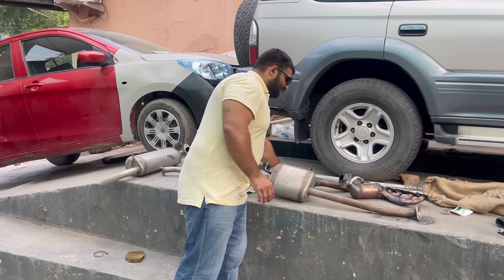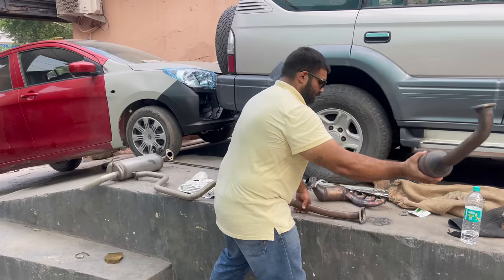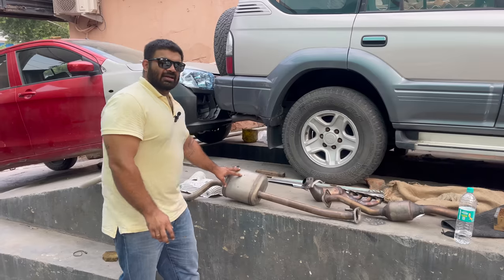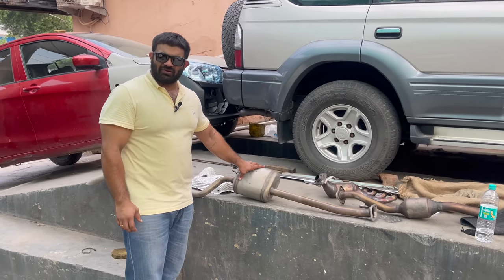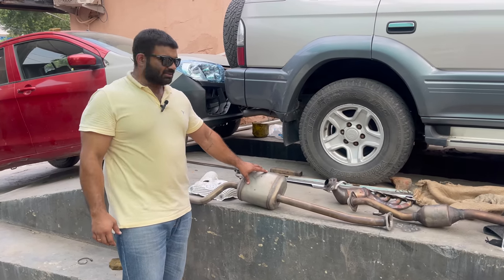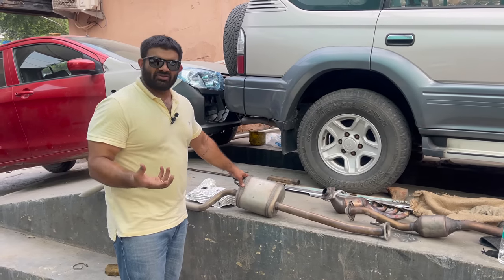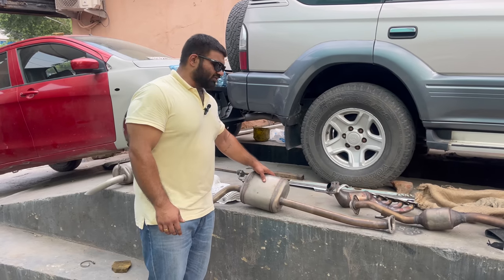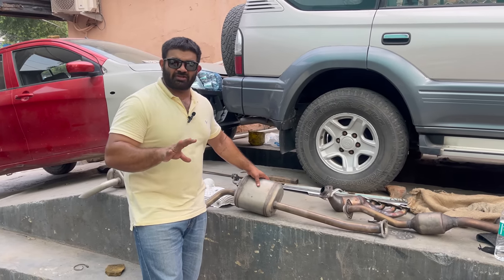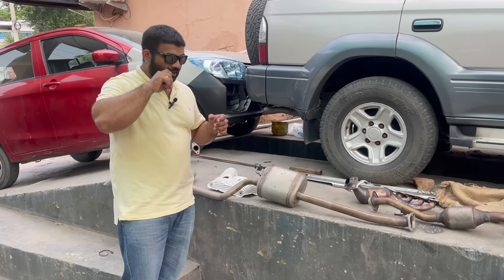After this comes this bit right here, which fits in this kind of a shape. This is your regular muffler — this will eliminate sound. This is the primary muffler, also called a flame catcher. As the name suggests, the flame catcher primarily prevents flames going out the back and also eliminates the drone. Drone is something like — if you've got a full exhaust and you're driving at a specific speed, you'll hear a humming sound from the exhaust that becomes a headache after a while. This eliminates that drone.